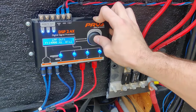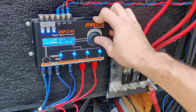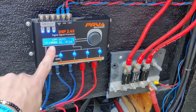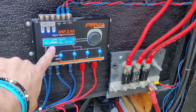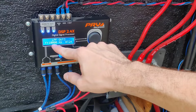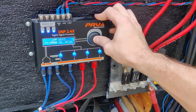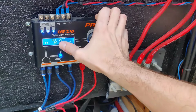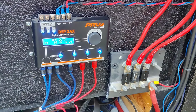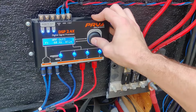Now let's go back over to our channels. This is channel 3, so this is my mids, my 10-inch speakers. The low pass, again, is the highest frequency that you're going to play with the speakers. The highest that I'm going to play with those 10-inch doors is 10,000 hertz. And you can switch to high pass, and it's going to play 60 hertz. High pass is the lowest frequency you're going to be able to play. Like I said, you can go up, down, change your slope, whatever you want to do.